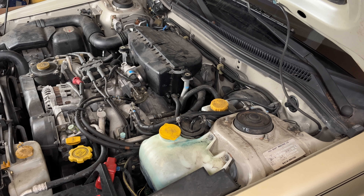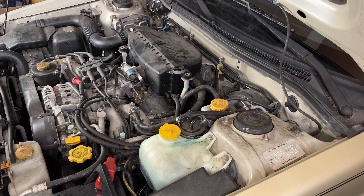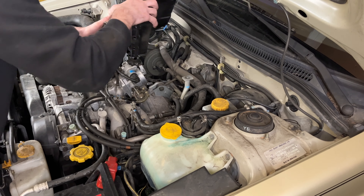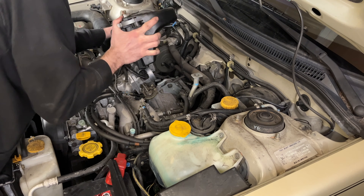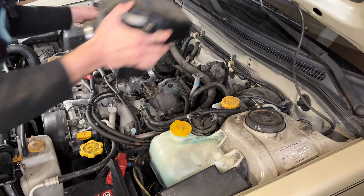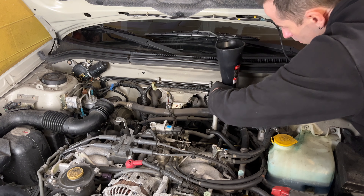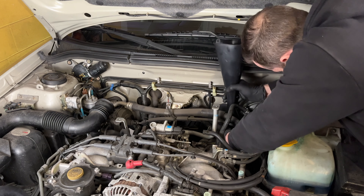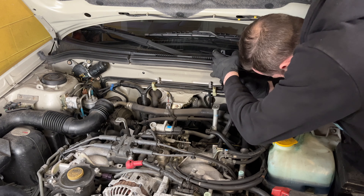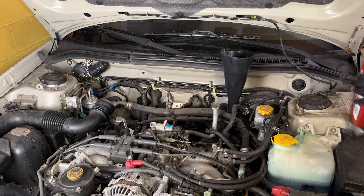This air box comes out super easy — I'm sure it's been out before. It's two small hex bolts, I think they're tens, and a flathead or an eight gets that band off. We get in there to the diff and just pour a little fluid in there — it's a little sneaky to find back in there. The transmission dipstick — you can see it right there, it's not hard to find, there's just not a good camera shot. It was basically a bunch of vacuum hoses and heater hoses, so I spared you that.